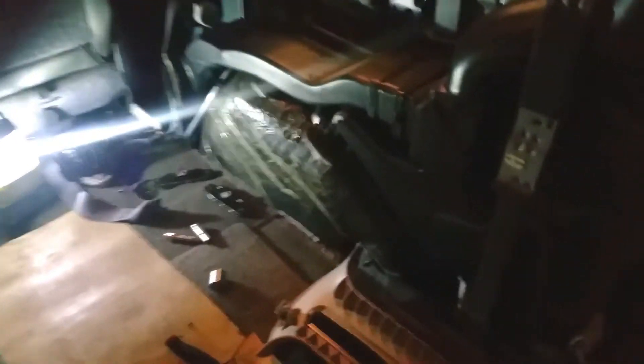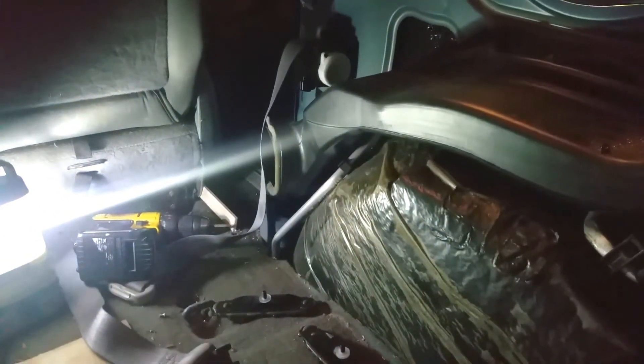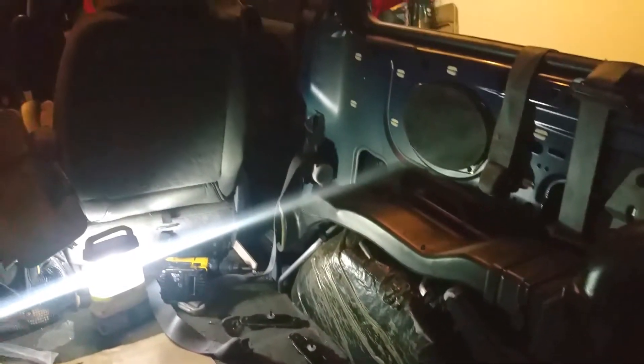After doing that, there is a piece over here that has all the vents for the rear heating and ventilation — that just pulls out with snap clips as well. The one trick with that is you do have to remove the seat belt from up there; that was a 14 millimeter bolt. You also have to remove the seat belt mounts from down here, as well as on the other side for the second row seat belt. Those were removed with a 13/16 socket.